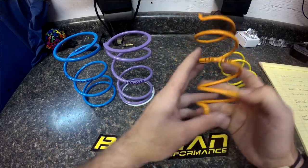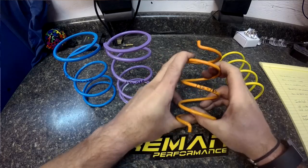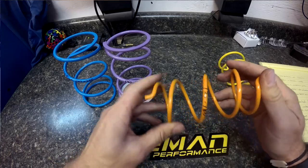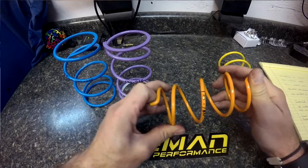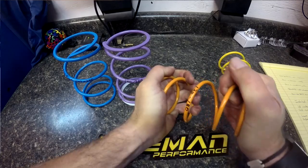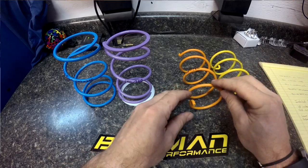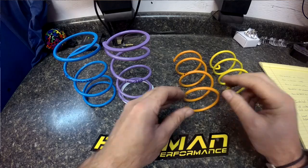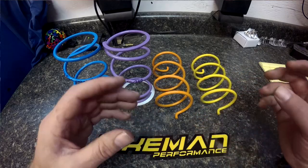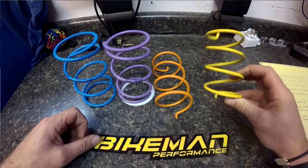I do really like torsion springs. If you have a clutch setup that has an option to run compression or torsion — and we do sell some kits for clutches that will convert a compression spring to a torsion setup — I like the torsion setup because as it starts to open, the secondary clutch winds and progressively gets more and more belt squeeze. At higher speeds when belts are creating the most heat, putting a little more side load on the belt is what the torsion spring does, and it makes our belt life last longer. On some of our sled models, we gain as much as eight miles an hour just by switching to a torsion spring.